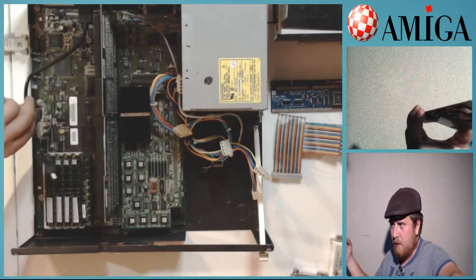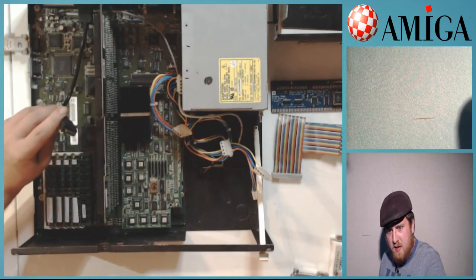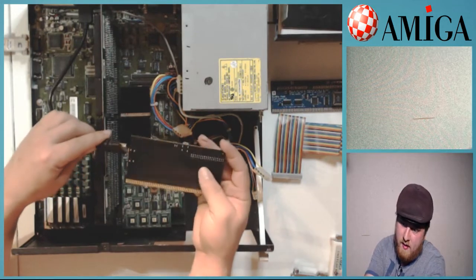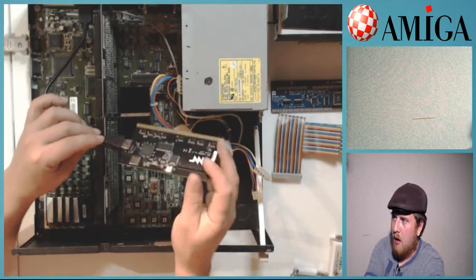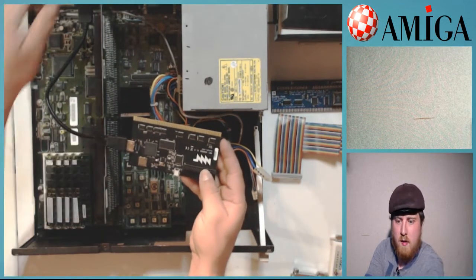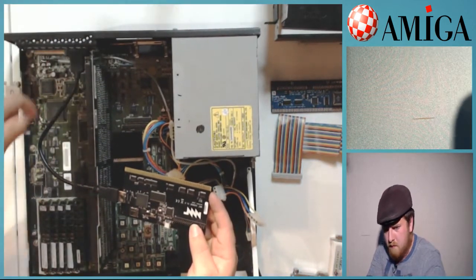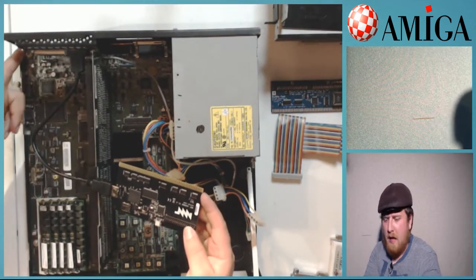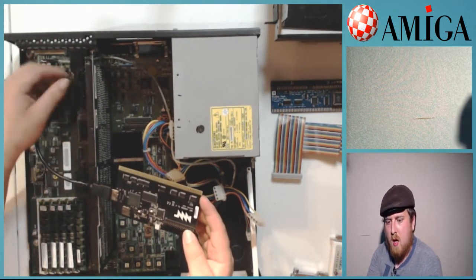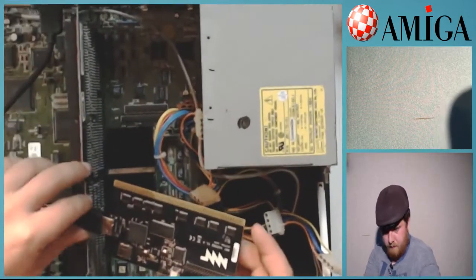And for our machine, we do have an HDMI hookup that goes here like this, just to show you. That is a hookup from the port on the graphics card that gives us another female port out the back of the machine. Simple little adapter with a modified bracket that we Dremeled out to mount the HDMI output, basically, to take this output to there.